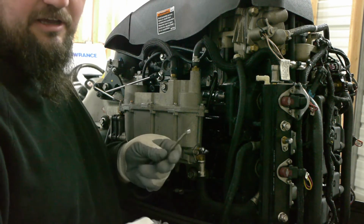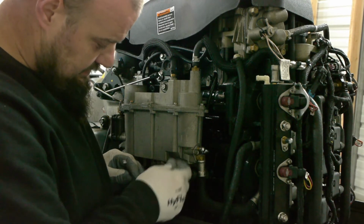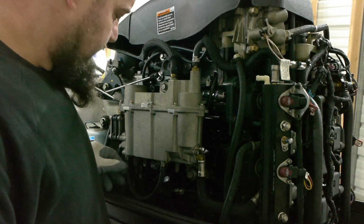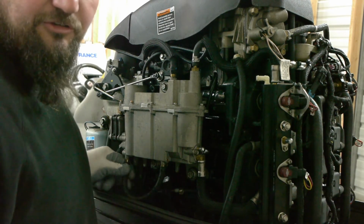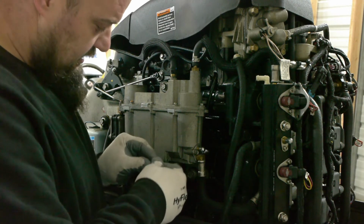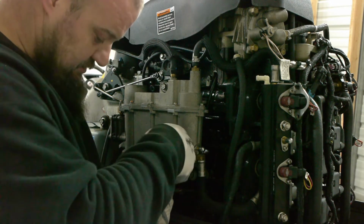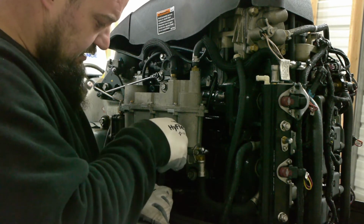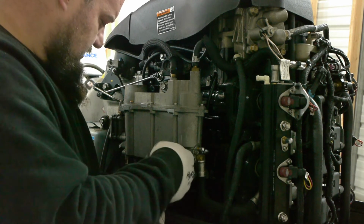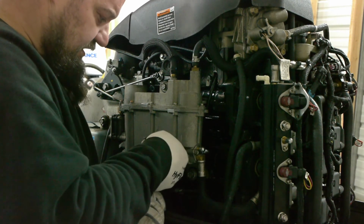I use a wrench and a little bit. What you're gonna do is pull one side off, usually the closest side to the filter, and then each side has a drain plug. Normally you'd have a bucket under you. And then you loosen the Allen. You don't take it all the way out, you just loosen it. I'm using this because the other side's a little tighter to get in.